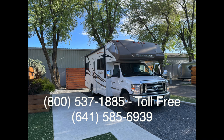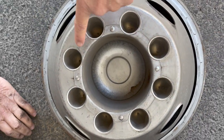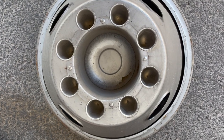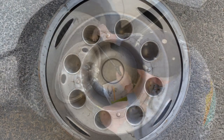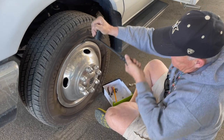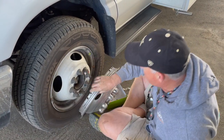At this point we decided to call Winnebago customer service, and here are the facts. Mini Winnies do not have removable nuts on their wheel simulators. The nuts are decorative and will break off if you twist them with a T-handle tool. Wheel simulators on Mini Winnies pry off — they're held on the wheels with spring clips along the outer rim.